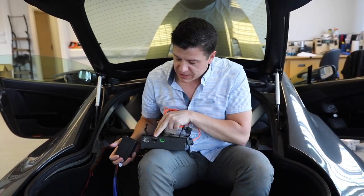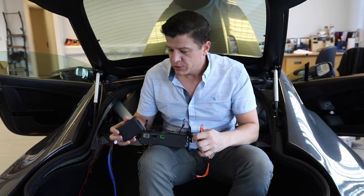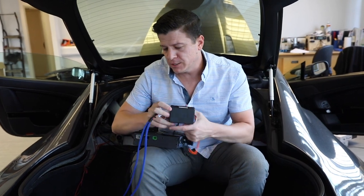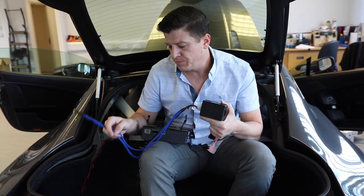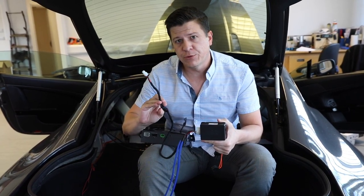So we're going to be disconnecting the factory fiber optic connection, adding in a bit more so that we can connect to a fiber optic aux input box, which has connections that go to our CarPlay module and also to our new loom that we just ran through the center of the car.